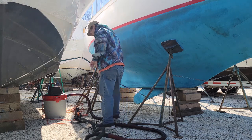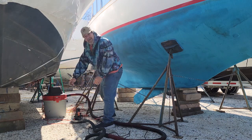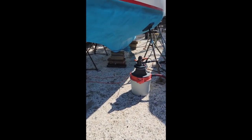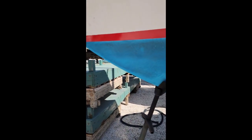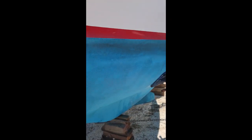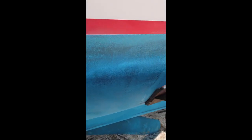And see, it's done even faster this year. Kind of a deal, right? So it's a 6-inch sander on low speed. I used one disc. Normally I'd use half a dozen with a 5-inch. 45 minutes, and I've got 75% of the boat done. Got to break out the 5-inch.